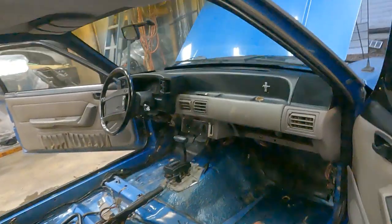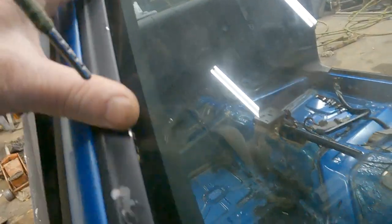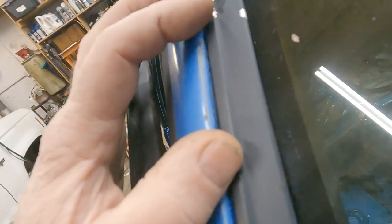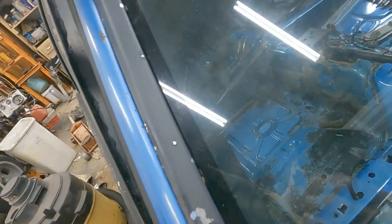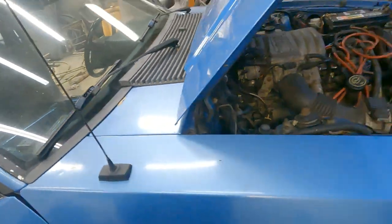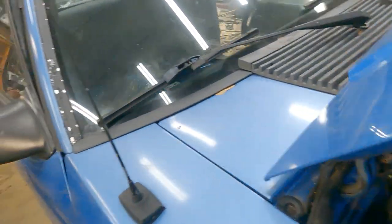When I first got this car I had to put a windshield in it. Once I cut it out I could see where it had like three windshields already been put in. Come to find out, behind this trim where the roof line and the A-pillar is soldered together, there was a big hole out there on the side. So the windshield wasn't even leaking it — it was running down the A-pillar, coming inside the car. And that's probably from the factory like that. Poor old car.